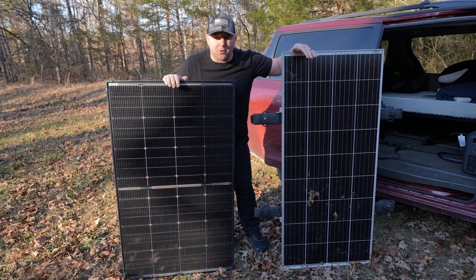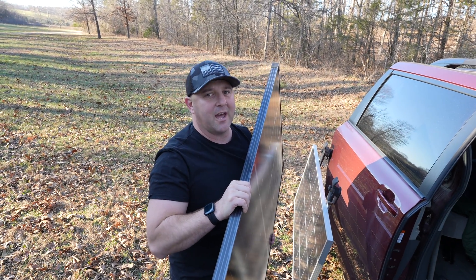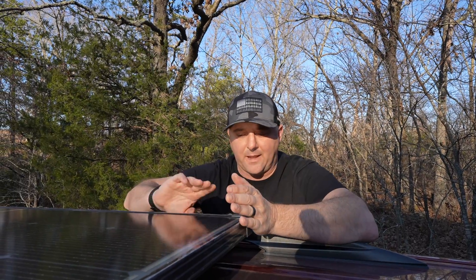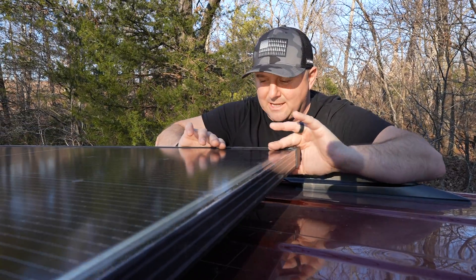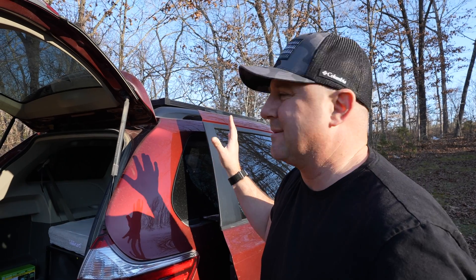The new solar panel is a little shorter but a little wider, with roughly the same overall footprint. Before going further I want to drop it on the roof and see if it'll actually fit. The main positioning consideration is I don't want too much of the panel extending beyond the roof rack crossbar — there's a bolt hole about five inches in from the leading edge, so that's where it'll sit. With this shorter panel, the tailgate clearance issue I had with the 180-watt panel doesn't seem to be a problem at all.